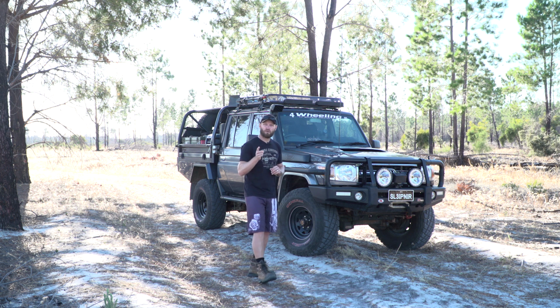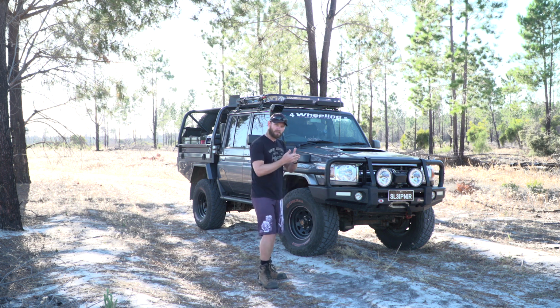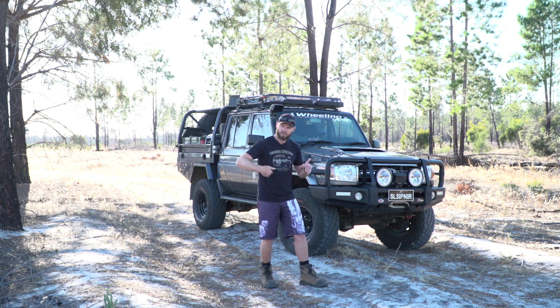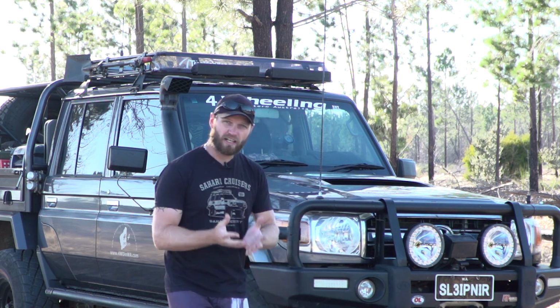But when you're in four-wheel drive and you hit the bitumen, the energy can't be released either side as easily. But the problem is the bind up that happens from the power split. You're sending 50 to the front, 50 to the back. Your front wheels are going to do more travelling than the back wheels. So when you're turning, the outside one also does more than the other back outside one. If you go in a straight line, you should be okay because all the wheels have equal contact, equal distance travelled, equal rotations. The minute you start turning, you're going to get understeer. Everything's going to bind up.